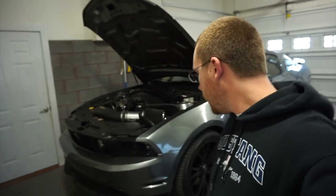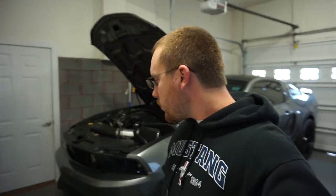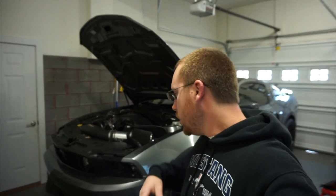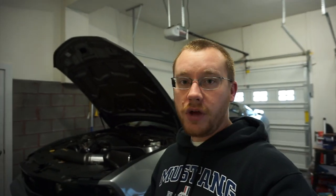With that, I'm going to go ahead and get the front bumper ready to come off the car because that's pretty much all the install should really entail. We're crossing our fingers we don't have to do any cutting. I have already previously cut the front fascia because I have a Paxton supercharger on the car, and that front intercooler does require you to cut from the back out for a little bit more clearance. So we're going to see how easy this is and show you guys everything along the way.